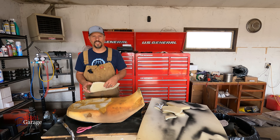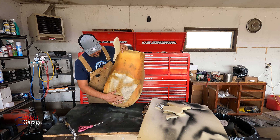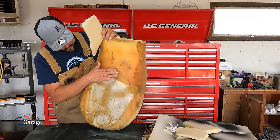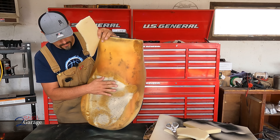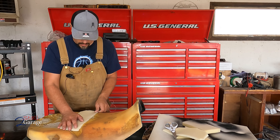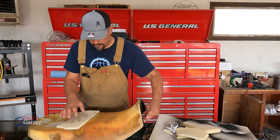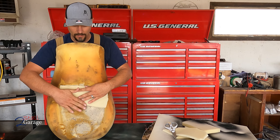As you can see, I changed the game plan up. I went with the orbital sander — it's just a lot easier to plane this down a little bit. You can actually use the edge of the sandpaper coming around on the orbital sander and you can kind of shave off — it acts like kind of a shear. The biggest transition we have is from the top to this middle section right here, and we don't want to see that in the final product. So we are going to put one of our thin pieces down right here, push it all the way over to the side, and it's actually going to fit really well — perfect right here. This is actually going to be good because it's going to tuck in on both sides and make a nice transition.